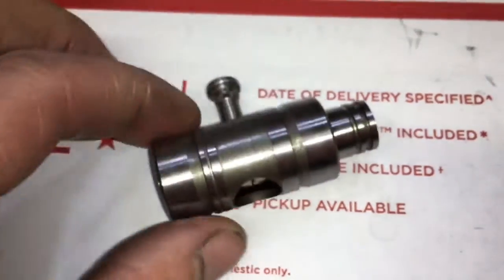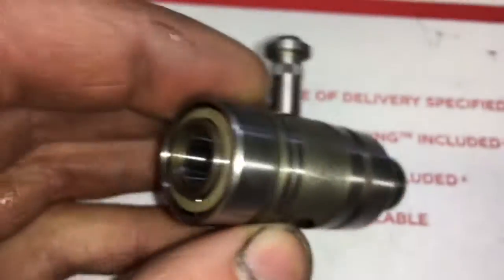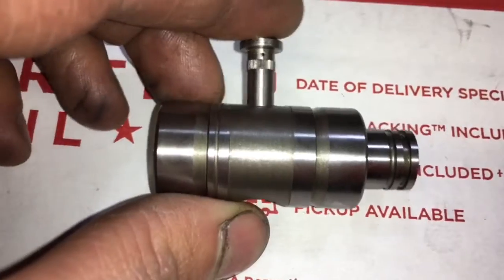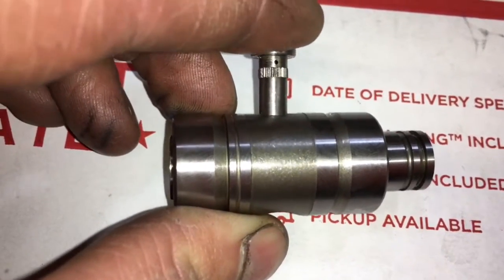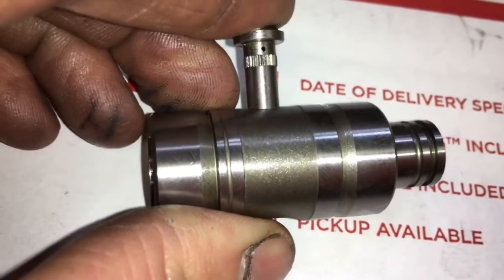Here's a clip of our cage. As you can see, it's basically identical. The only difference is that I had the pin fit tighter into the cage so that we don't have problems with excessive in and out play causing the wheels to hit the housing or the seals to just wear out from in and out shaft play.